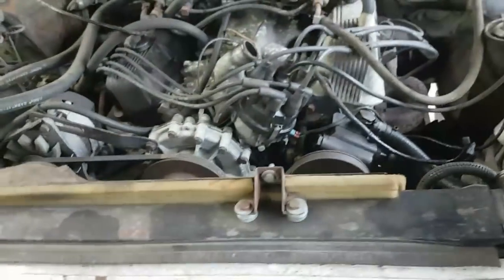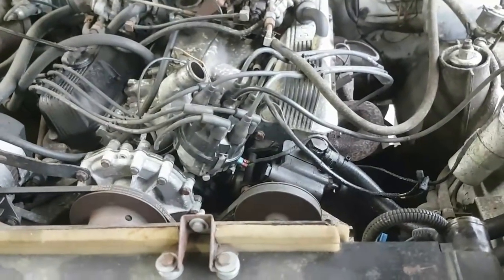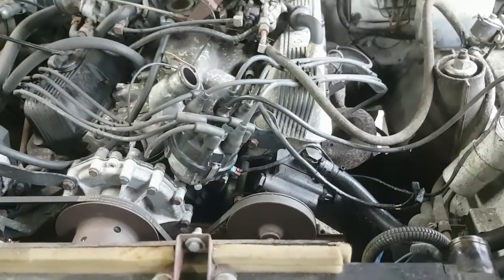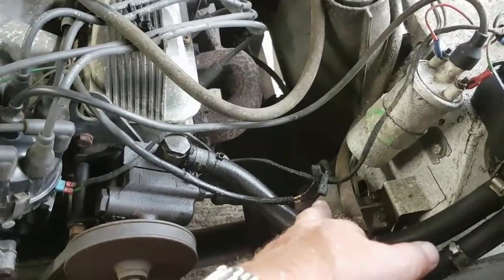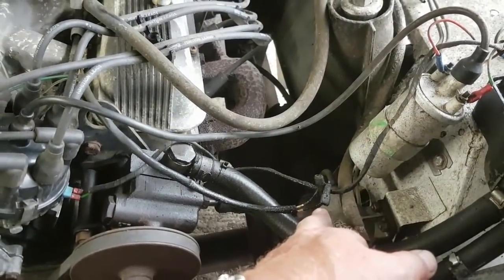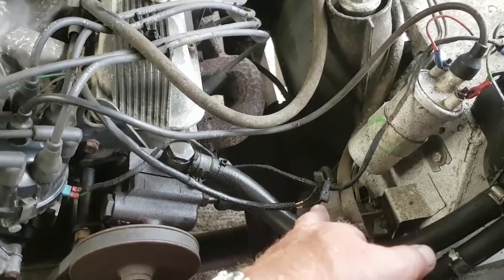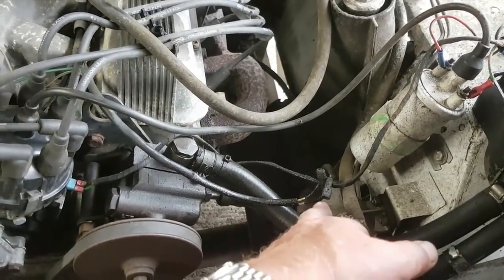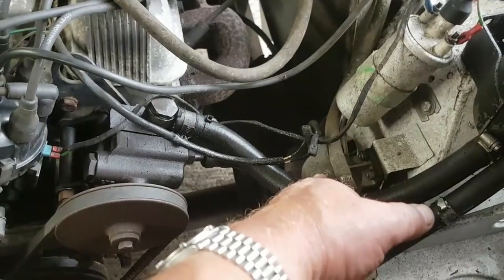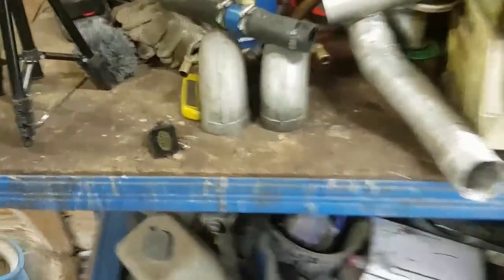Ugh. Right. We'll get something done, don't you worry. That's quite dodgy, actually, because one of those wires will be live when the ignition's on, and one of them will be live when the starter is turned. So it's not very well insulated, is it? And it's right above the fuel filter. Oh, we don't worry about things like that. It'll be improved, don't you worry.